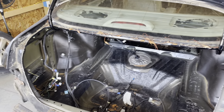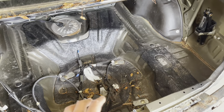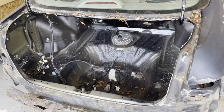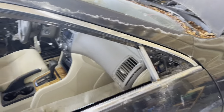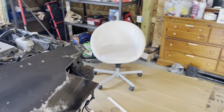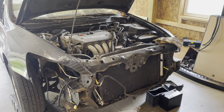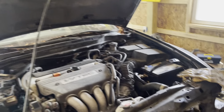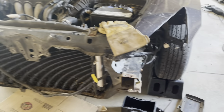With your wiring, if you're new to derbying, I simply unplug everything behind and in front of the motor — I don't cut anything, I just unplug it. For airbags, always make sure you have no power for at least a couple minutes after disconnecting the battery before you tinker with those. Just unplug them, then start the motor up to make sure everything checks out and she's not in limp mode.